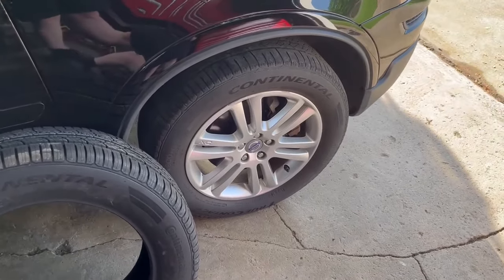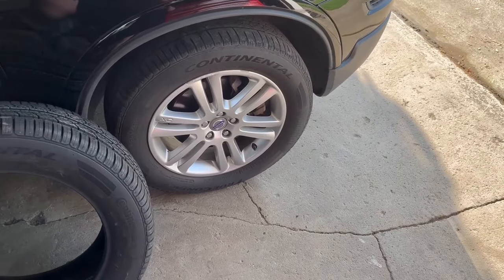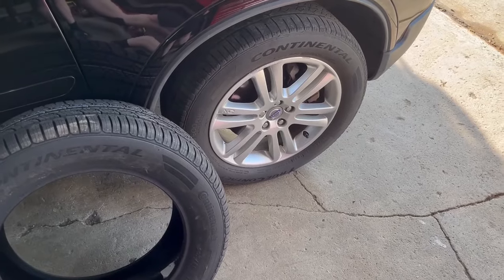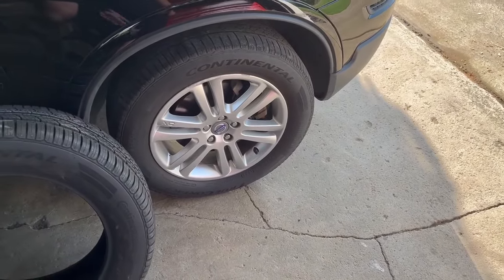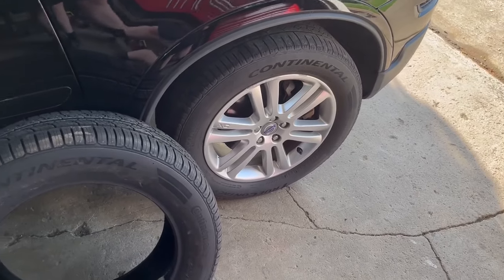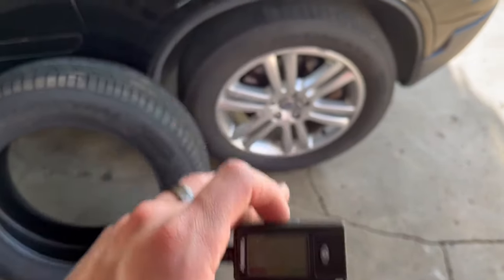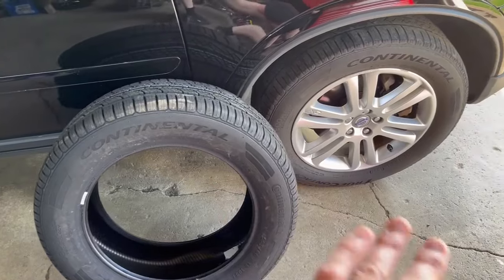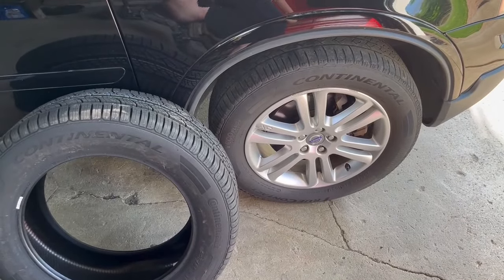You're probably going to get about a quarter of that mileage warranty at best. A lot of factors are in play: it depends on your car, the weight, how hard it is on tires. This is an all-wheel drive vehicle and it's hard on tires — I only get about 20,000 to 25,000 miles per set. So don't go by the mileage warranty. Get yourself a gauge and do the visual inspection method — that will be a much better determining factor.